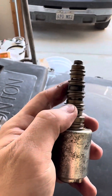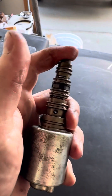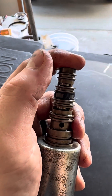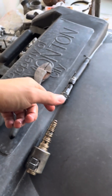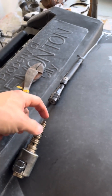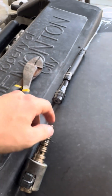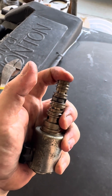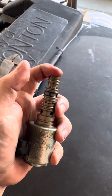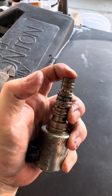So if you look at the old ones, there are these little slots — these little ports. And when you push the plunger in, it blocks those ports off. So you've got the actuator shaft that runs the vanes and it's basically cammed — not really a cam, but it's got the same shape. It pushes on this plunger on top and blocks off those ports. It's got a little bit of play before it even actually starts blocking anything off.